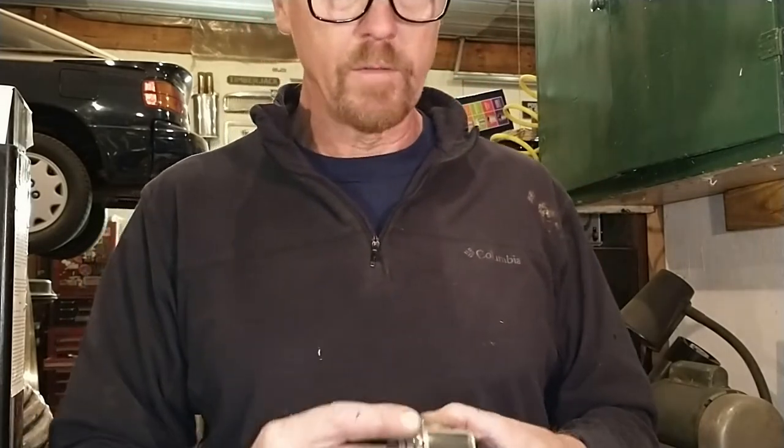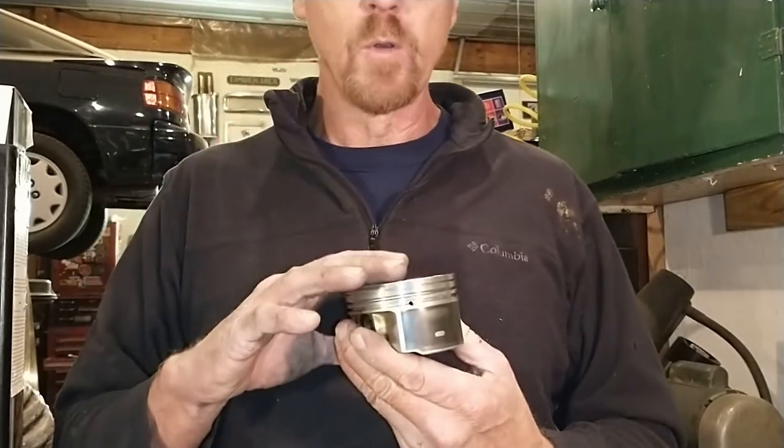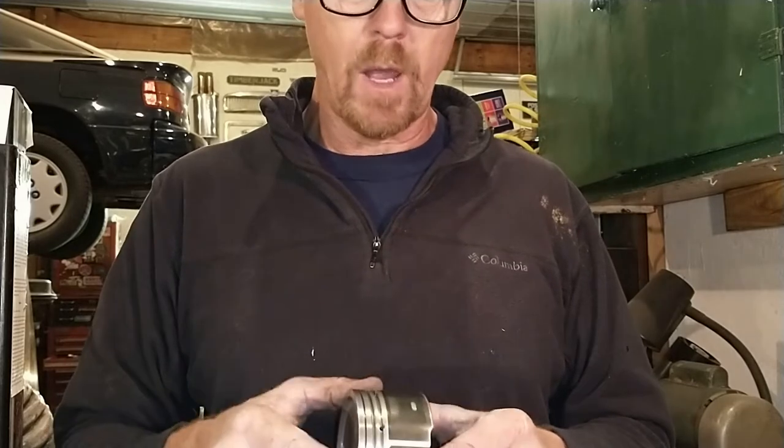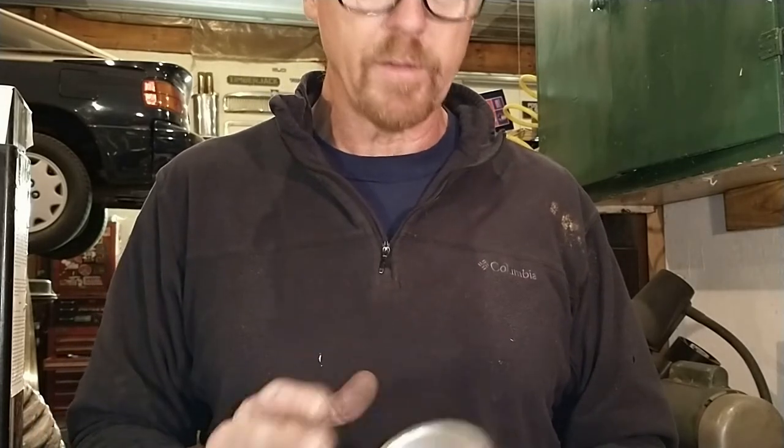Once the piston heats up, it's going to expand to its maximum size, and it's important that the clearance is dealt with. We've inspected it and we're going to look at the ring grooves before I put the rings in. I've already polished this up to make sure I didn't have any defects. We can use Scotch-Brite, but I'm very cautious with it because it can be a little aggressive — you can actually take a lot of metal off with Scotch-Brite. I go old school: I use steel wool. Steel wool is really mild; it'll clean it up and give it a little polish working by hand, but it won't take a lot of material off. It gives a beautiful finish.